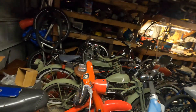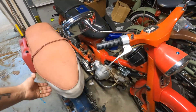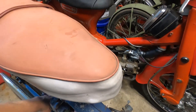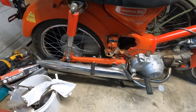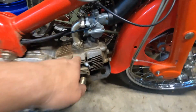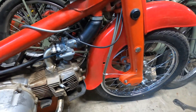Unless you follow my old campus bicycle page, you may not have seen this one until right now. I actually bought two projects. One of them is a Honda C90 or CM91 motorcycle. This was something that came up and I did not expect to buy it, but I sold some bicycles at a swap meet and this is what the fruits of my labor were. I have done some work to this bike. When I got it, a lot of it was kind of thrown together just to look like a whole bike. I cleaned up the carb and had a repair — that nut was stripped out so I had to size it up and thread it.